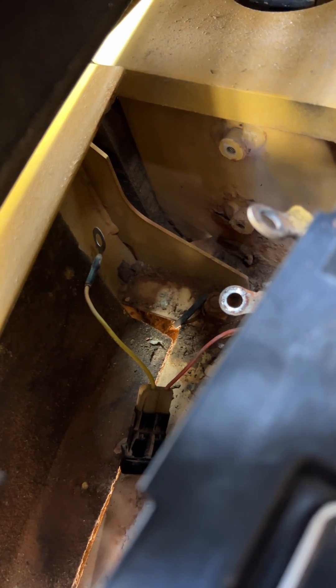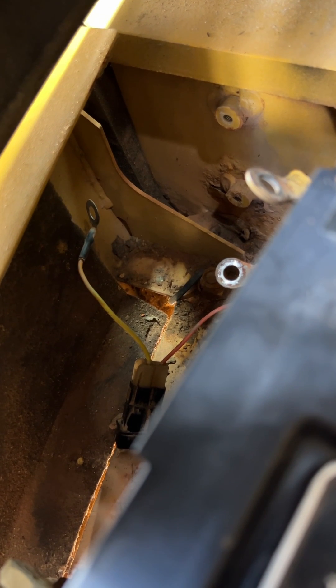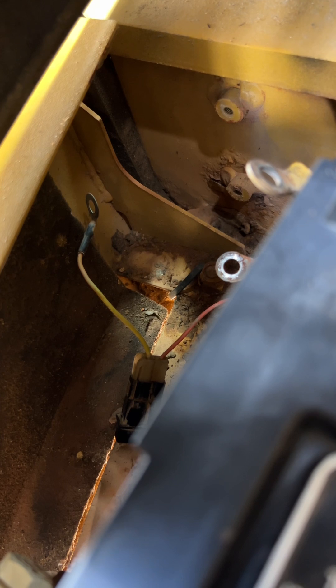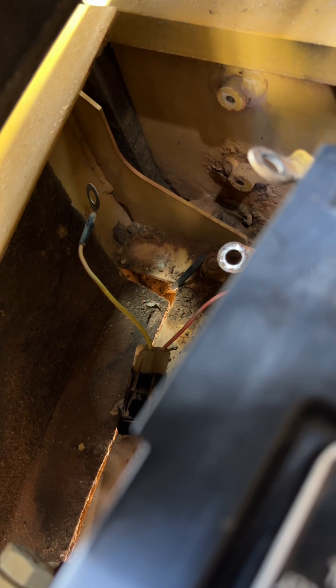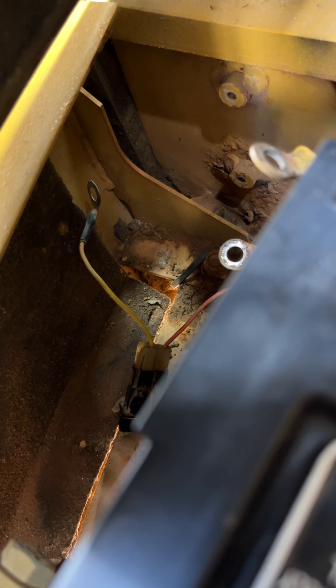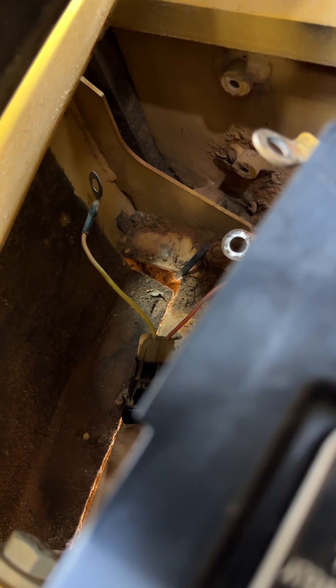There's also a little yellow wire down in there that goes to the side that goes to the actual air heater or the intake air grid heater. That wire sends a signal back to the ECM and tells it whenever it is basically above normal range, or if it's shorted to power, it would let it know — hey, it's above range. So that's what it's showing right now.